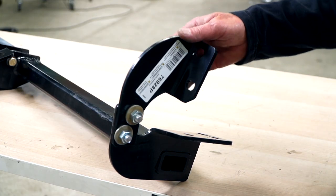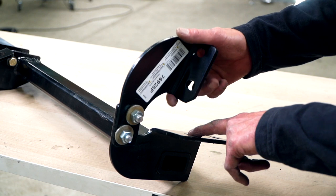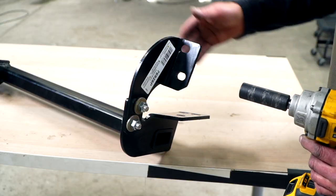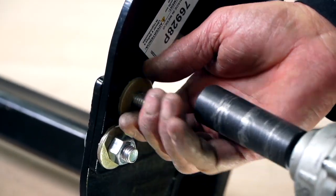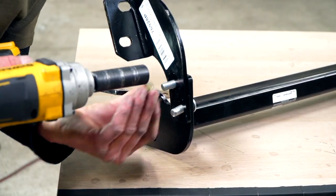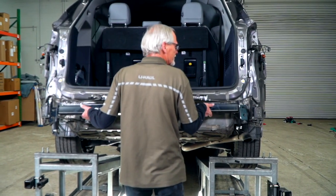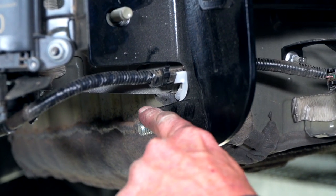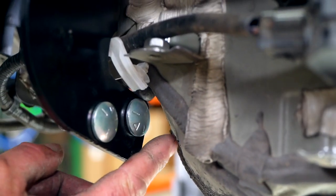Our hitch came with these end brackets already installed. However, when we tried to install it, the hitch would not fit — the cross tube will not go onto the vehicle without these being removed. So now we're going to remove both end brackets using an 11/16 socket. Now I'm going to bring my hitch into place, positioning it where the existing bumper beam used to be. Be mindful that the carriage bolts are in place before you place the cross tube onto the vehicle — there won't be enough clearance if you try to put them in later.